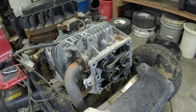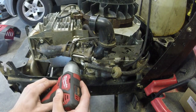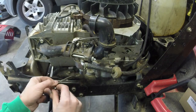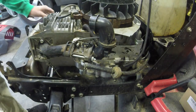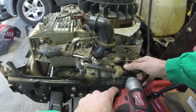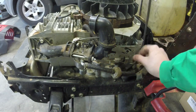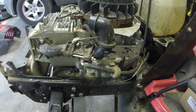While we've got this off, we'll take off the coil wire and feed it down through here. Underneath you have a ground wire on this side — that's a 5/16ths — as well as the ground wires right here. You have to pull this wire through because it kind of latches in those tabs on this engine. Then there's another 5/16ths here for the throttle. So we get that off, take the throttle cable off.